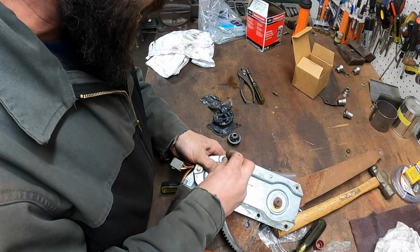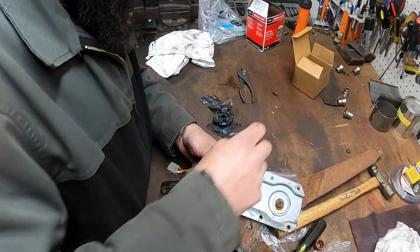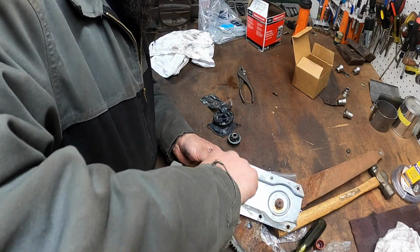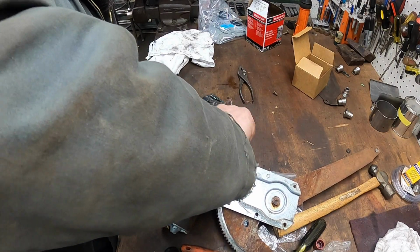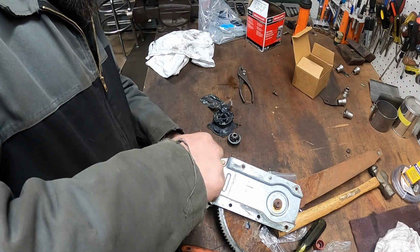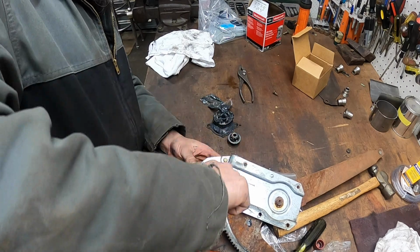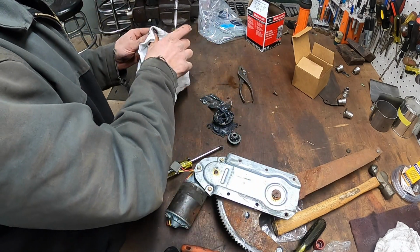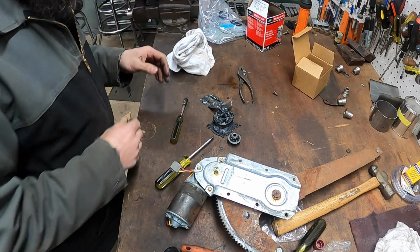Neither door lock is working, and neither of them works from either switch. So if I recall correctly, the system gets its power from the driver's side door switch. So if the driver's switch is bad, neither switch will work. So I think what we are going to do is we'll get the voltmeter out and we'll test for power first. I find it hard to believe that both door lock actuators have failed, but I suppose it's possible. So let me go grab the meter and we'll unplug the door lock actuator and test it to see if it's getting power or not. And we'll go from there.